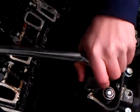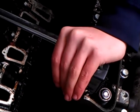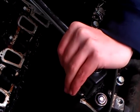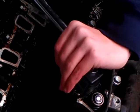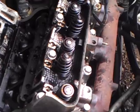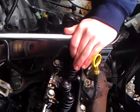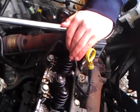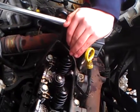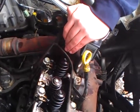He doesn't even have to worry about a click. You can tell when you're getting close because the beep starts going beep-beep-beep a little faster. As long as you keep a steady torque on it — if you start releasing the torque a little bit, the beeps will stop and you can't tell if it's a steady beep or not. What you can do is take the wrench off and it will tell you the last torque the wrench has been at. So you take a look at the face of the meter and you can tell if you've made it up to your torque level or not.